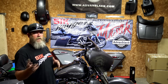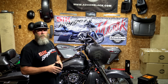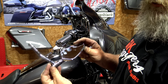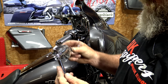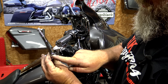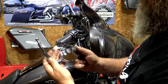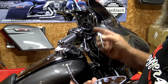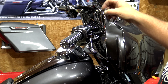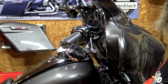Here's the mirror — I got it out of the package and just want to flip it around and get a close-up for you. This is the Performance Machine Aero mirror. Right on the end here is an allen head bolt so you can loosen this and actually move the mirror, and then the mirror pivots here as well. You have your stem, and by already testing this — this is a 2014 Street Glide — I'm going to have to use the longer stem to get through that really thick perch with the hole.